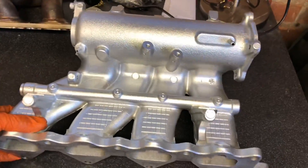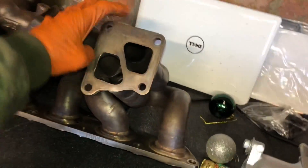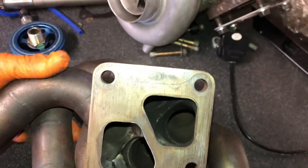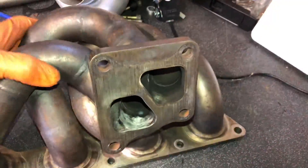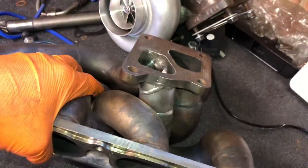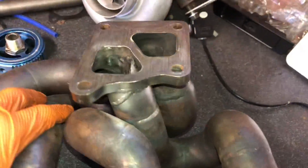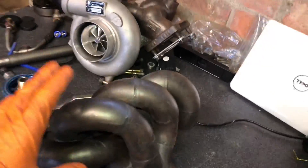The inlet's been painted up — I decided to give the inlet manifold a quick cleanup and repaint, and you can see it looks better than brand new. We've also got the exhaust manifold back; it's all been welded up inside. You can see it's TIG welded and it's been ported back out so there's no restrictions in the runner. The crack went into the collector itself, so we've run a bead of TIG around there.